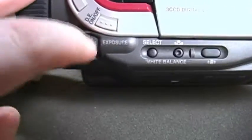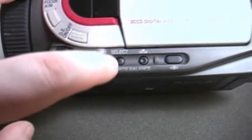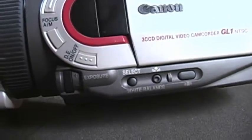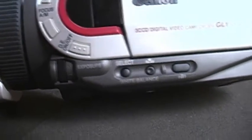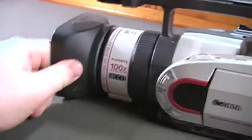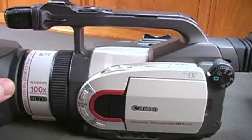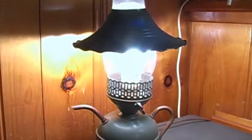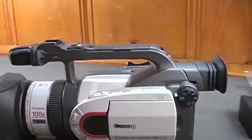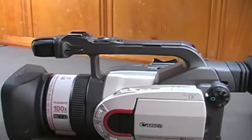There's an exposure button which you push in and then adjust accordingly. You have two buttons for the white balance — one for preset white balance settings and the other for manually adjusting it. You just put something white like a sheet of paper in front of the lens, press that button, and it calibrates the white balance accordingly. Very useful, because despite using these LED high-efficiency lights, a lot of camcorders still don't get the white balance right and end up making everything a sickly shade of orange.